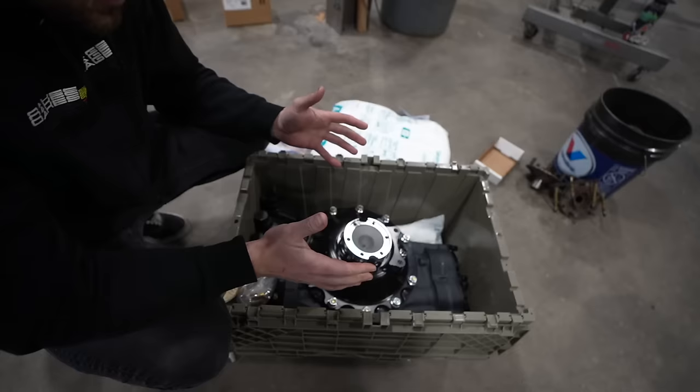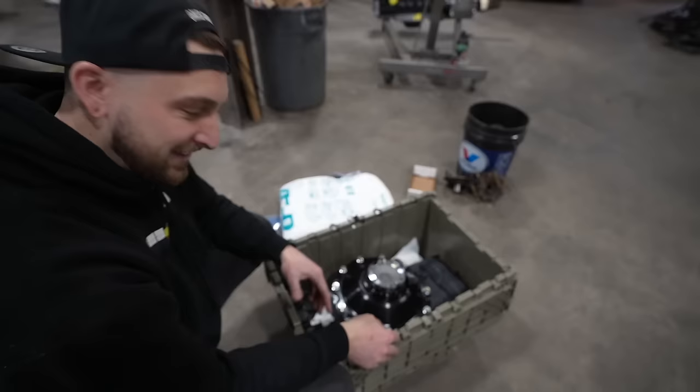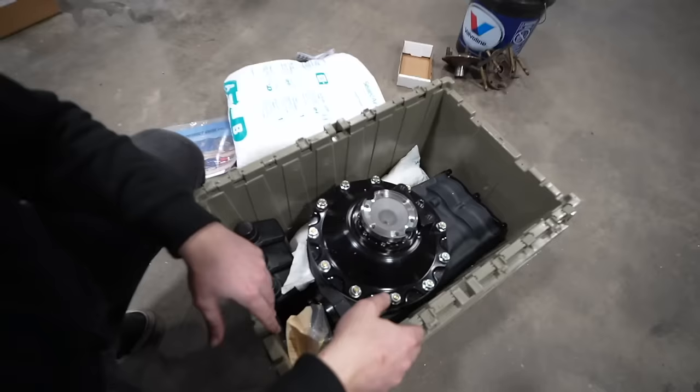Let's get this thing out of the crate and check it out. It came in a crate — not just a box. So let me brag about the Bulldog just a little bit. With quick changes, the best part is we're able to pull this cover off and change the gear ratio of our differential in just minutes. Gearing is a huge part of drifting — being able to balance the wheel speed and chassis speed helps you balance your power-to-grip ratio and makes the car as fast as possible. With this, we can dial in our gear ratio and wheel speed in just minutes, which is huge. We've never had that opportunity.